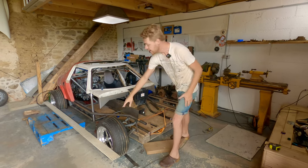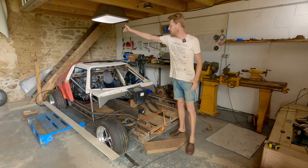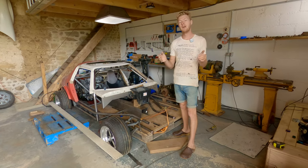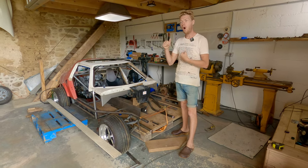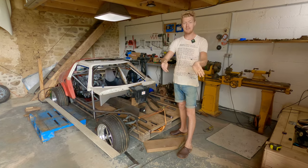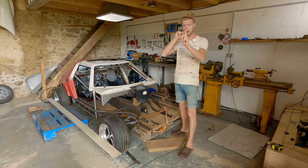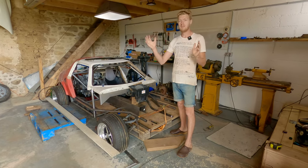Your track width is the center point to center point of one axle. So you've got a rear track width and a front track width. Most cars are narrower at the front. That causes them to understeer, so the front end slides. So in the event of overdriving, the car would plow straight, which is nice and safe, rather than spinning backwards and doing the old school Porsche 911 thing. It won't pirouette down the road, it will just go straight. So that's 99% of cars.